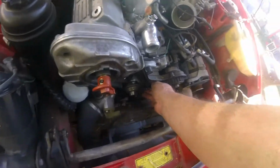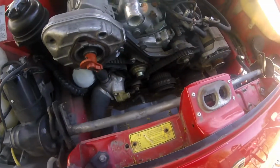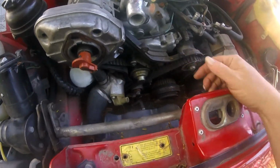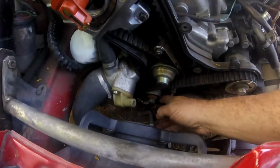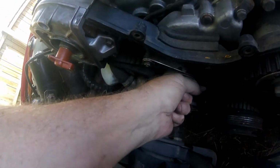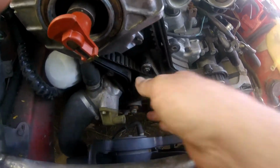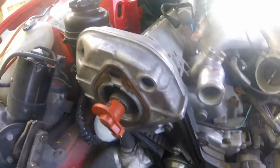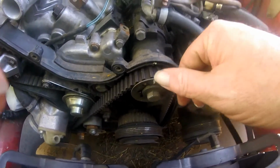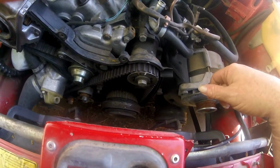This meets the, turn it 90 degrees. That's the old school version for doing the tension, and that's how I'm going to do it. The idler roller here is tight. I mean, it still spins, but this part's tight. If I had a grip, you can still hand turn the water pump, barely. That's a good sign. I already checked the marks there. The mark is still lined up here. You saw a little bit ago that the timing mark on the flywheel is where it's supposed to be.